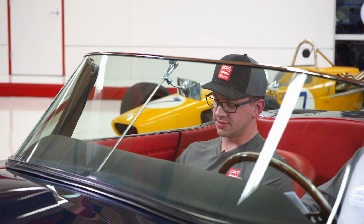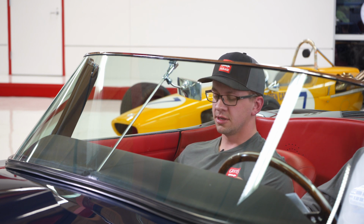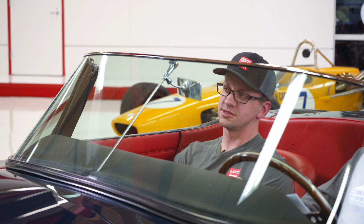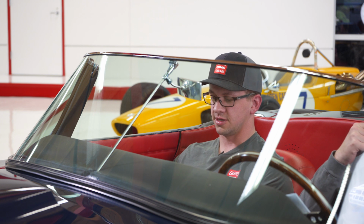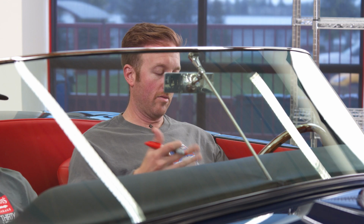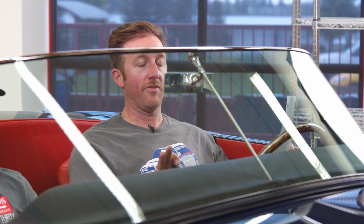Yeah, and he's asking relative to paint work. He said he just had some paint work done on his car a little over a month ago. Products like Speed Shine, which is technically not body shop safe either, aren't leaving behind enough protection to cause issues with relatively fresh paint. So that's another one that will be okay to use. Quite frankly, you could use Best of Show Detailer in that situation if you're just trying to keep your car clean while they say 90 days to off-gas before you put a sealant, wax or coating on there. Use any of those detailers fine. But the term body shop safe generally means silicone-free, for use in a paint environment where silicone can contaminate paint and cause some big problems.